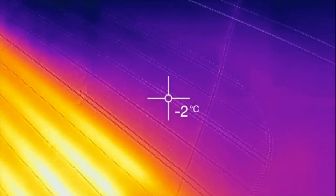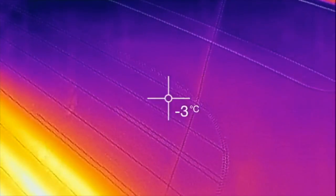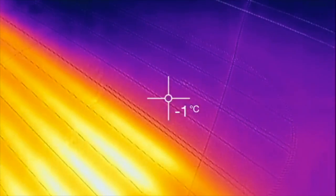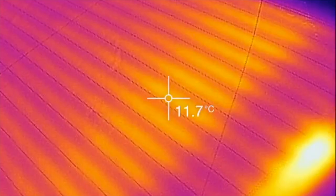In fact it looks to me like it's probably a balun. So those last few elements at the very top - one, two, three, four, five - are not actually heating elements, they're actually part of the FM radio antenna.